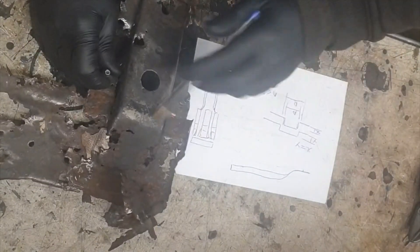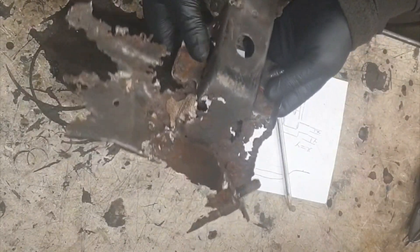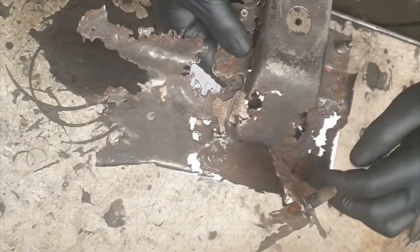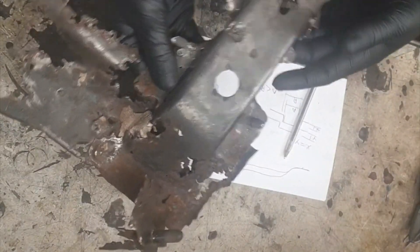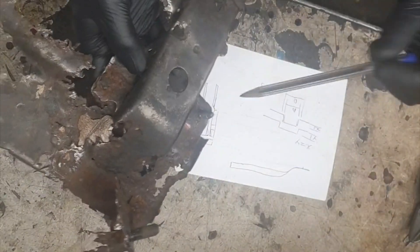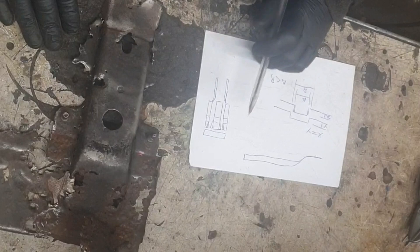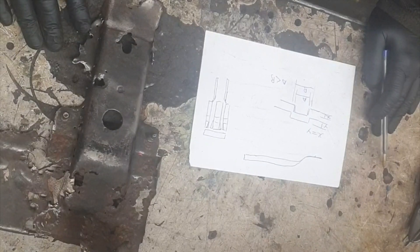The next step in this restoration is to make one of these — or rather two of these — because I believe it's the same on the other side; it's an identical pressing on each side. I could just hammer it out but that would take a while. I could make it out of three pieces of metal and weld them together, but it's not the right way to do it and it's not how I've done the rest of the car. So what I'm thinking is I'm going to make a custom press die for it to use in my vise. It doesn't seem that complicated — I think it'll be easier than trying to beat them out of a piece of flat, and quicker as well because I've got two to do.